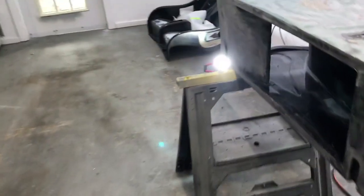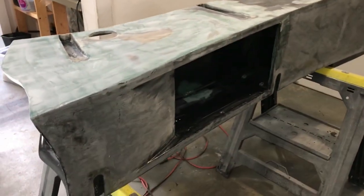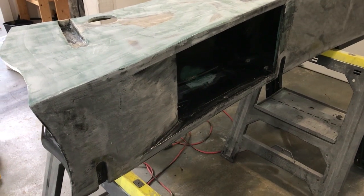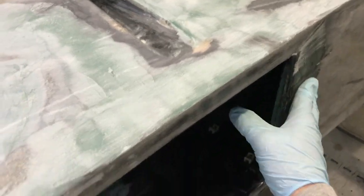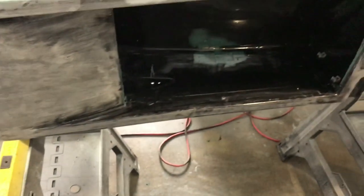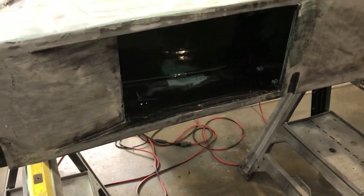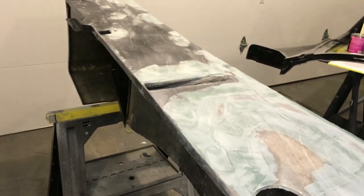These side pods are kind of poorly designed. First of all, they're hard to take on and off because there's so much stuff basically permanently bolted onto them, but they're also just kind of poorly made and kind of wobbly. So I've put stiffening material in behind all these sections so it's nice and rigid, and I've backed them with additional matting and epoxy on both the front and back. And then I've squared off and leveled the underside, which gets scraped up and banged up as the car gets used. And I'm just trying to make it absolutely perfectly straight, which is ridiculous, but I'm doing it.